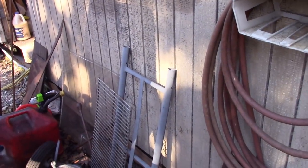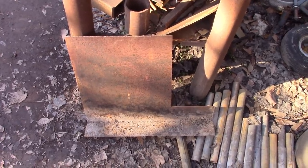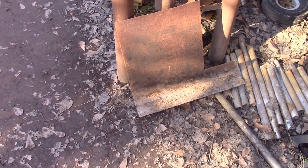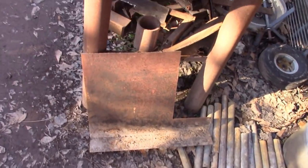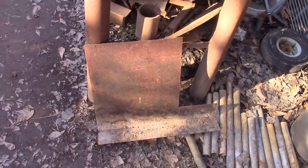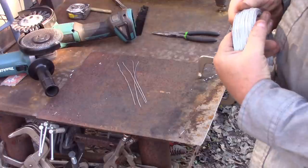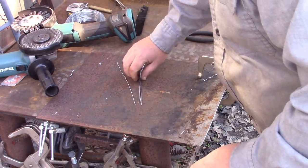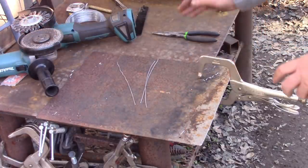What I've got to do now is build some kind of heat shield using this piece of metal here. It'll be a heat shield for the pipes — they are kind of thin-wall pipes and I had several suggestions that I need to protect them a little bit because they may try to burn through. I'm going to add this thin piece of 16 gauge metal. I'm going to hang it up in the top just to sort of protect those tubes a little bit. This was a very good suggestion by one of the viewers in my second video — these will go just like this and wrap around the pipe.